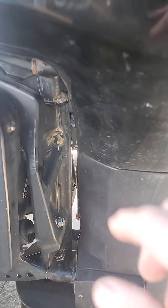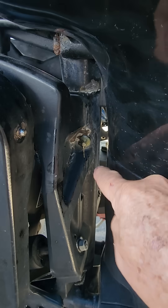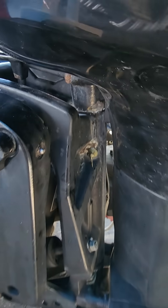What's happened is it hasn't been properly greased over the years, so this top bushing here is stuck. I tried to pump some grease in it and it took some, but it only came out the bottom — it's not coming out the top, so this top bushing is seized.